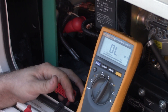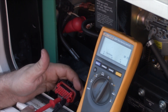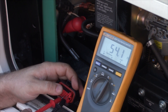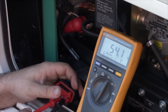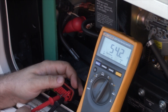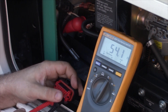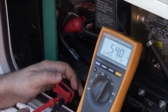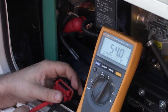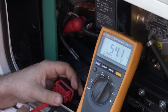That will require pulling the generator out of the coach to dismantle and investigate. For this reading of 54, that isn't very bad. Most likely the friction from the engine running again will clean that up and get it right back to where it's supposed to be. The brushes kind of clean the rings as they run anyway, which is why you should exercise your generator monthly to keep those rings clean. Anything higher, or anything that doesn't come down after you've tried spinning the generator over a few times, you will need to pull the generator out and clean the rings manually.